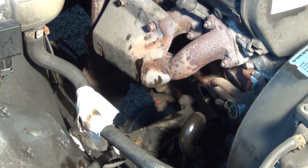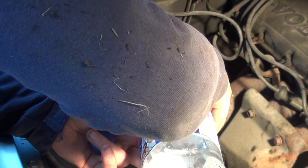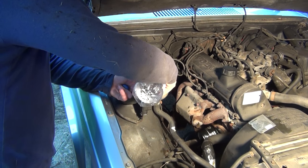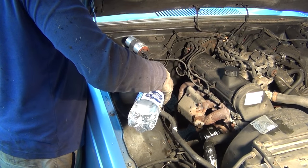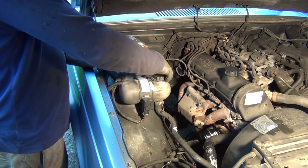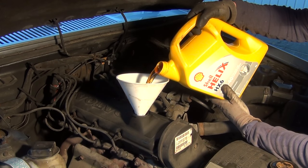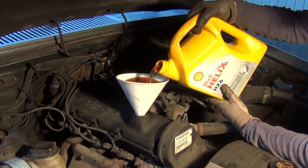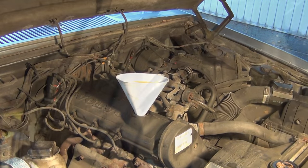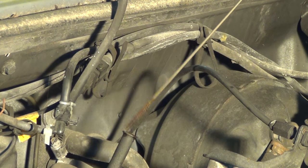Oil film applied — let's screw the new filter on. Before I go on to fill new motor oil into the engine I reattach the cooler hose and top off the coolant reservoir with some ordinary tap water. In winter time I would add some anti-freeze of course, but judging by the duct tape I will have to replace this entire hose soon anyway. I reinstall the drain plug and fill some new motor oil into the engine, following the specifications from the Haynes manual using 10w40 — about 3.75 liters, which the dipstick readings back up.